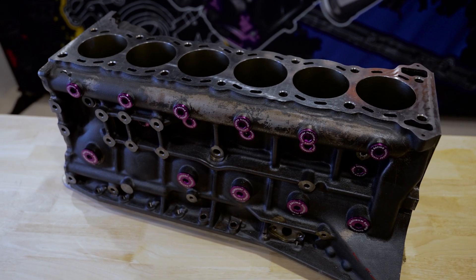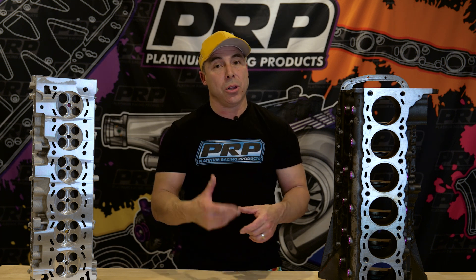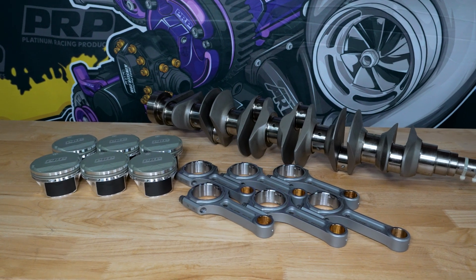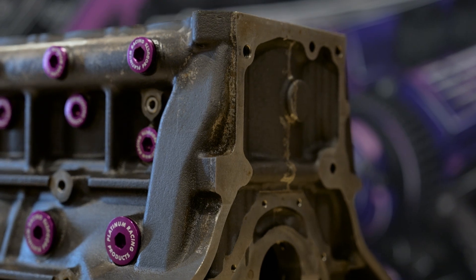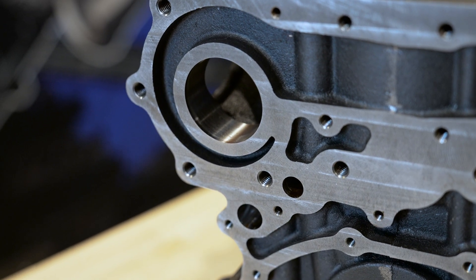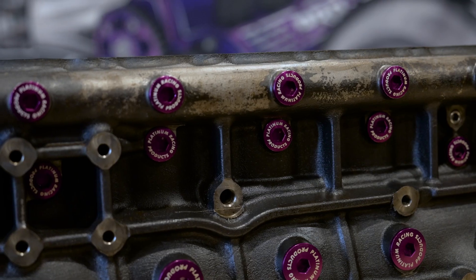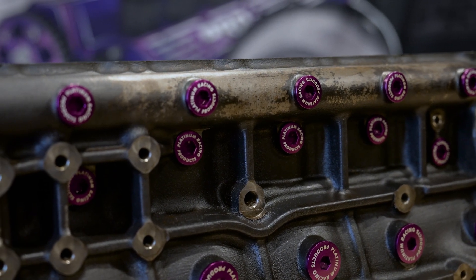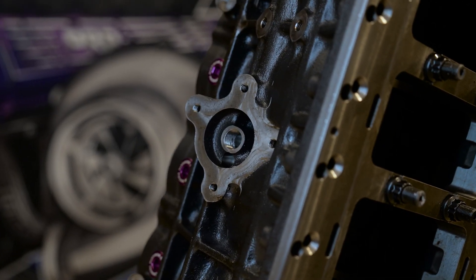This gives us a really nice con-rod ratio in our 90mm bore RB30 short deck. We've got a three-liter high-revving build with a 79mm stroke crank — high revving, large capacity, big piston, longer rod, great rod ratio. We get the best of all those worlds to give you higher capacity, big torque, high revving, and an awesome-sounding RB28-type RB. You don't have to do all the mods to fit an RB30 block in your engine bay. Motive Video has done videos on how to get an RB30 to fit into a GTR — we're trying to avoid all that and keep everyone on a short deck block with the displacement.